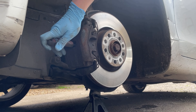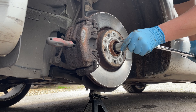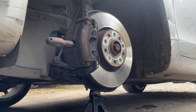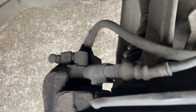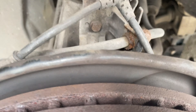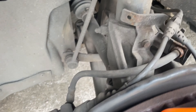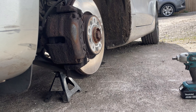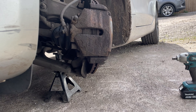First I'm going to stick a screwdriver between the caliper and the rotor to stop it spinning, then use my 27mm socket and breaker bar to break off the drive shaft bolt — because if I don't do it now I won't be able to later. Then I'll disconnect the ABS sensor connector, take it out of the hanger on top, same with the brake wear sensor and the brake line. Get all that up and out the way, then get this bracket off with the 10mm.